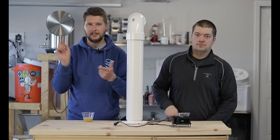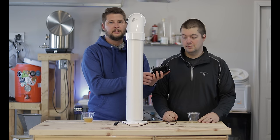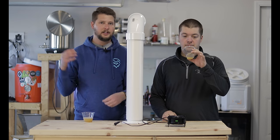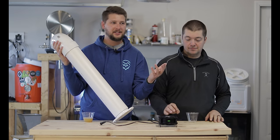So it's a 4-inch PVC pipe, two feet long, a 90-degree fitting, and a flange. Links in the description for each of those pieces, and an Amazon link to the 120-volt fan we purchased. It just sits right on top and helps recirculate all the air to keep your keezer the same temperature all around.